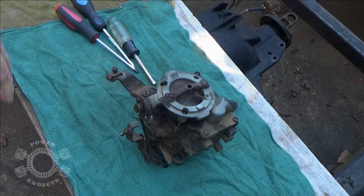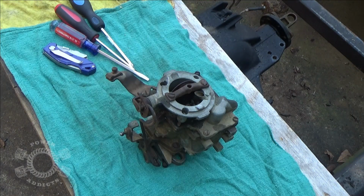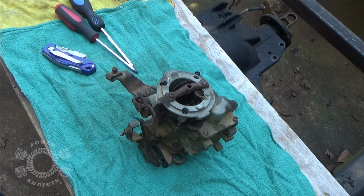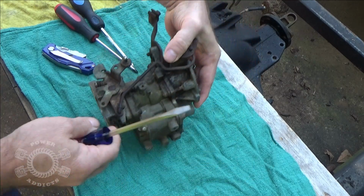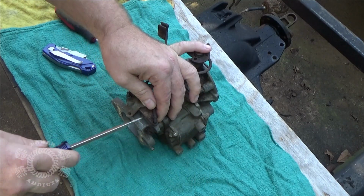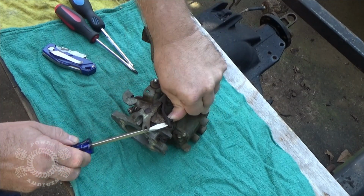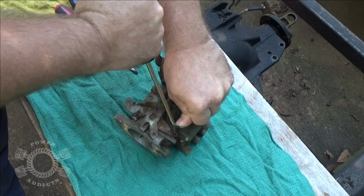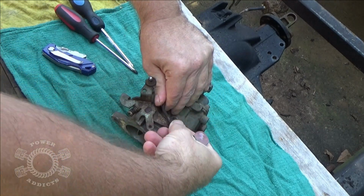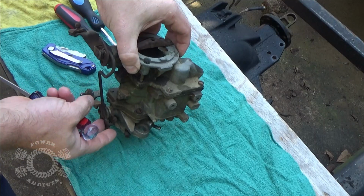Now, let's get this carburetor torn apart and see what's going on inside of it. This is not going to be a how-to-rebuild-a-carburetor video. This is more of an exploratory thing to find out what's going on inside of it, the reason I'm not getting fuel coming through. I tried to reach down with a flat screwdriver and discovered I had a nut driver, so I had to go get a flat screwdriver. Most of the time on these old school carburetors, your top horn, or top section right here, is mostly all flat screws. Here you've got a clip. Pop that clip, pull it up, pry it up. Get your finger out of the way so I don't stab myself. And it then slides off like that. Usually you leave it attached with just a little hairpin clip, but I just need this top horn to separate so I can get down to the float, needles, and all that fun stuff.